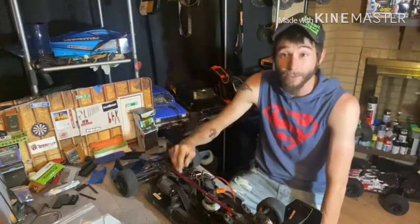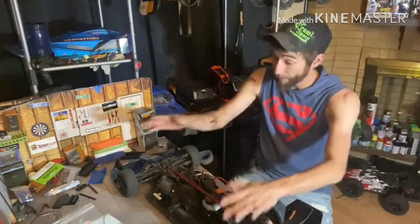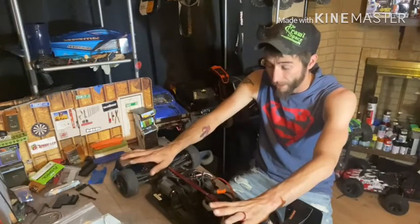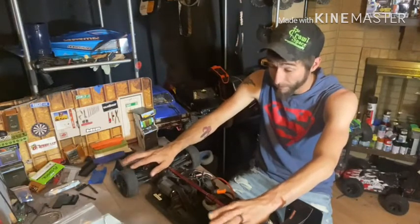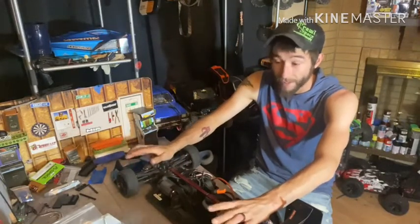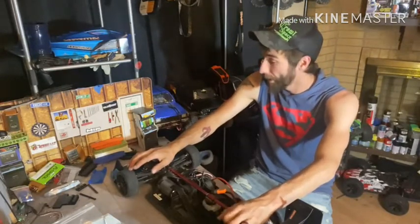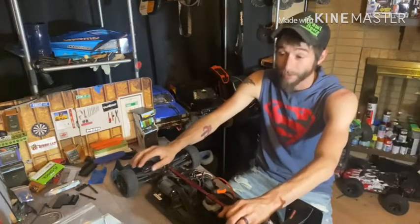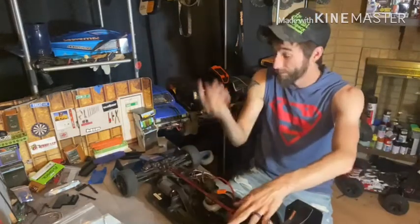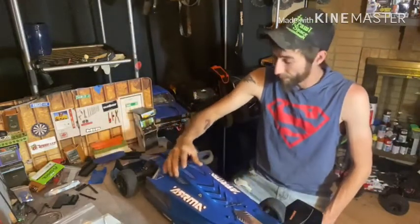I'll try to add in at the end of this video the last couple speed runs I did this weekend. So for right now, gearing wise, from the people I talk to, I am there. I am capable of about the 110 to 115 range, even with this motor and tires. I need some higher discharge batteries, a higher C-rating battery. It's one thing I haven't really splurged on yet, and I really should. So that is where we're at now. We'll add a couple of those speed passes in there.